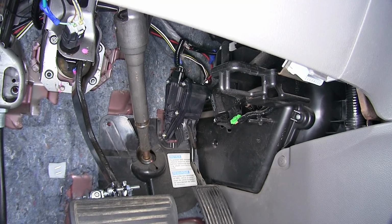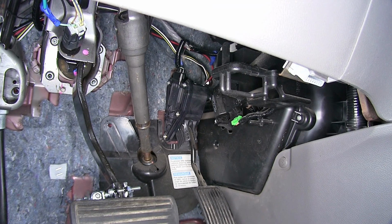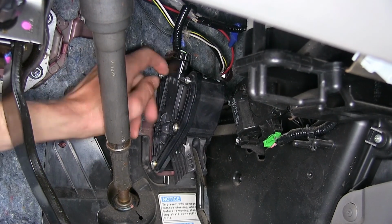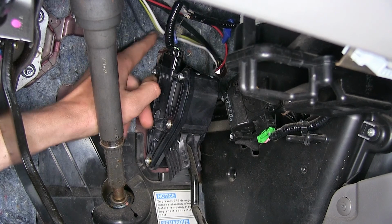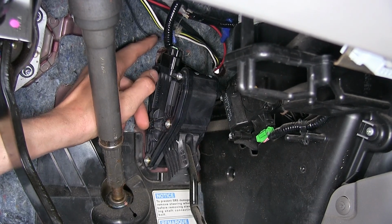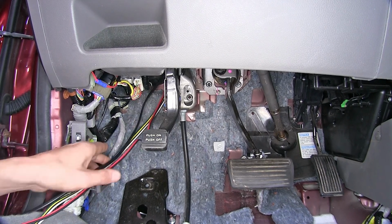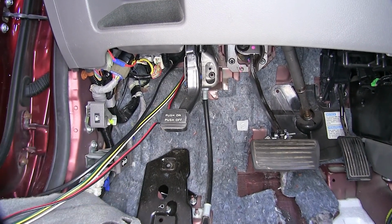Okay, our electrical wires, including our power ground, the connection for the breakaway, and then the 4-pole flat wire, we routed through a grommet in the firewall. So you can see where they exit the firewall right there. And we routed that behind the electrical wires for our accelerator pedal, one behind our brake pedal, and behind our parking brake assembly, where they come out right here. And we will tuck them down underneath our carpet now.